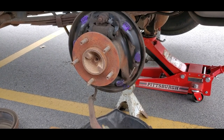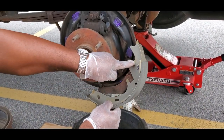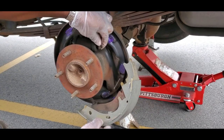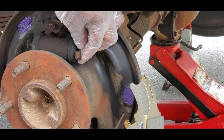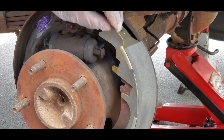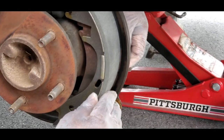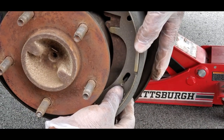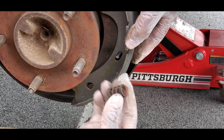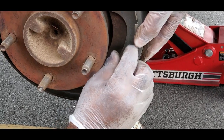The next thing you want to do is bring this brake shoe up. You're going to have a cutout right here - a half moon opening - that goes into the wheel cylinder. Your wheel cylinders have pistons that will pop out, and there's a little groove on the top and the bottom so it sets right in there. Make sure you line that up into there. Guide your pin to the slotted hole. One finger holds that forward.